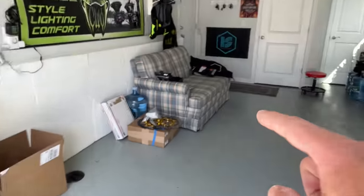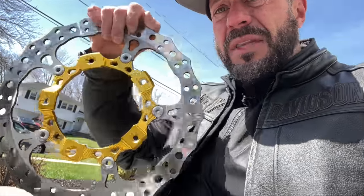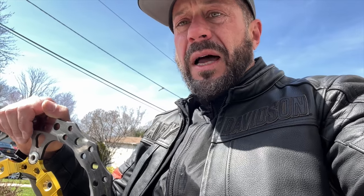Let me first tell you guys that the brakes are absolutely unbelievably awesome. I'm always gonna tell you guys the truth. The day I left JD Cycle Works, the day we put these rotors on, I immediately had a problem. If you don't know, I'll tell you again. I left JD Cycle Works after he did the big build on the bike. We put this 14 inch Arlen Ness big brake rotor kit on Silverback. As soon as I left, going down the road, applying brake pressure, I immediately felt the lever pulsate. I knew something wasn't right.